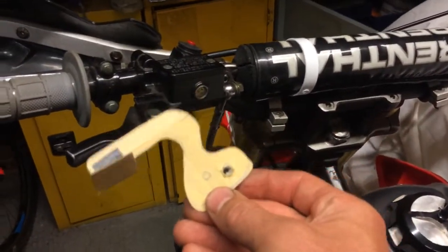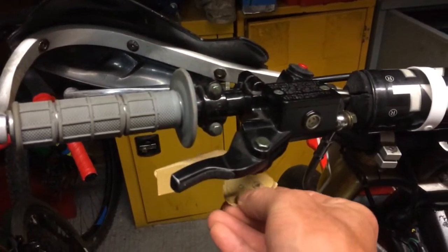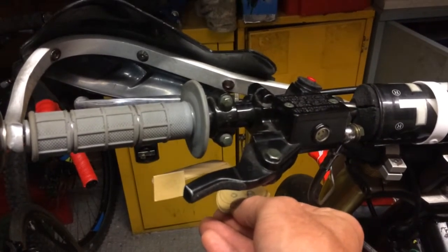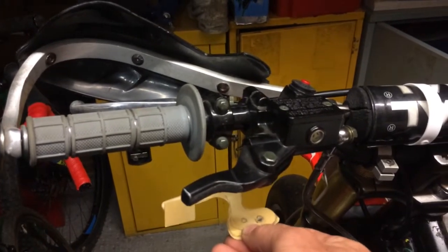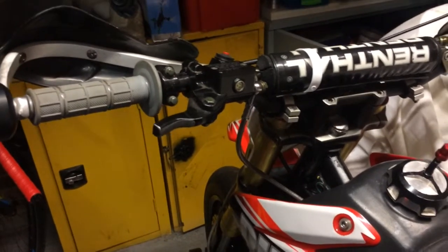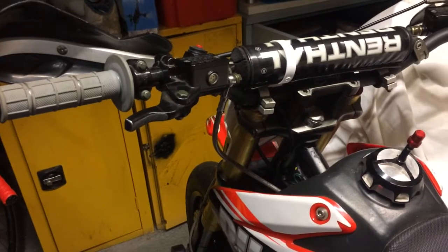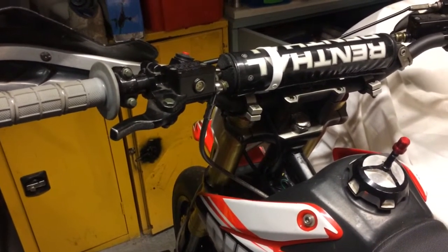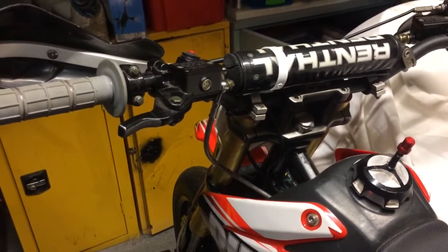With some cardboard engineering, we're going to make some spacers up, drill the lever, and have a proper thumbbrake that would be a lot easier to use. It's quite a popular part now for the pit bike scene and in World Superbikes and MotoGP. People are using the rear brake more and more. From what I've read online, it's quite a good thing to do if you're running a touch wide on a corner — apply the rear brake slide and it pulls the bike back in line.